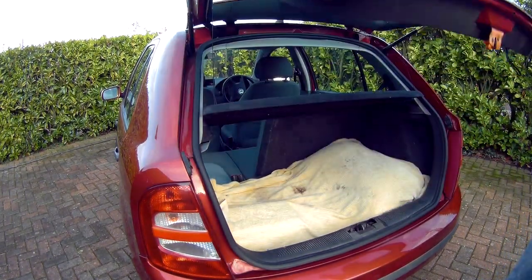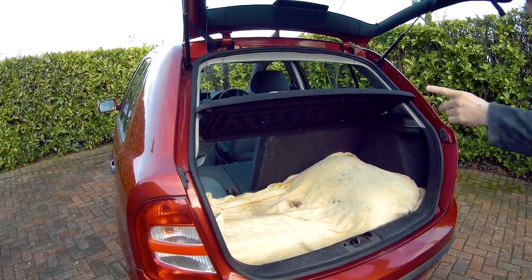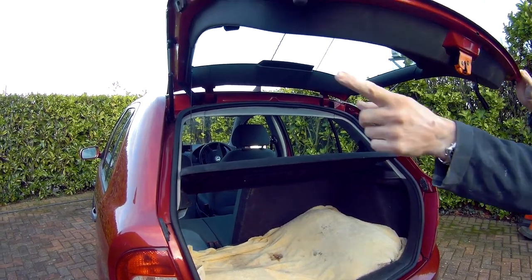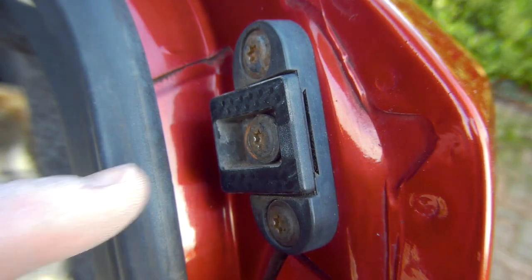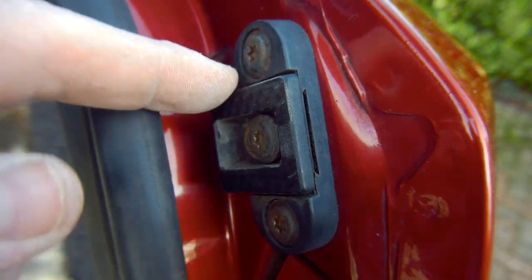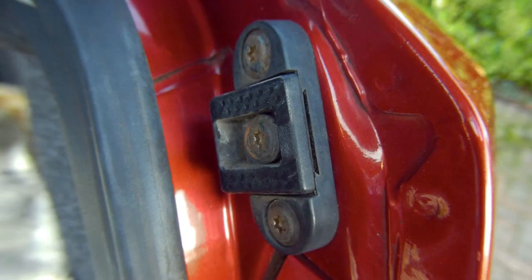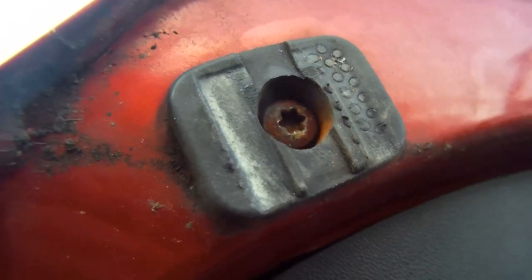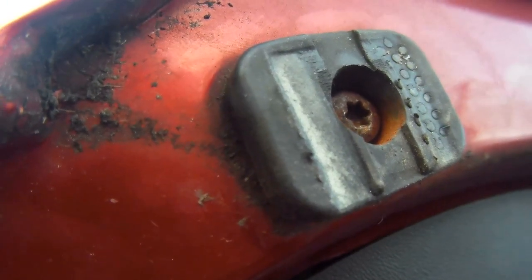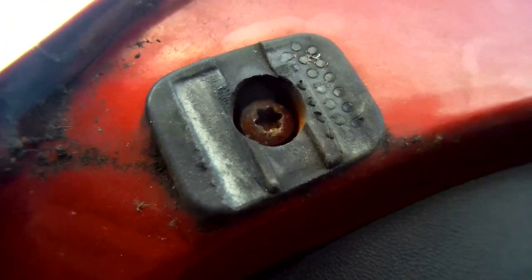If we open up the tailgate, there are four adjusting points — one here, one here, and two on the tailgate itself. Looking at the ones on the body first, there's a central wedge-shaped section that is separate to the bracket's body and can be adjusted forwards and backwards along a channel. The surface of the wedge marries up to another bracket on the tailgate, which is slightly worn. The tailgate lowers down onto the wedge-shaped bracket to align the tailgate centrally with the lock, which doesn't seem to be adjustable.